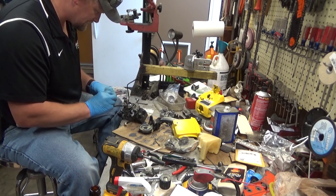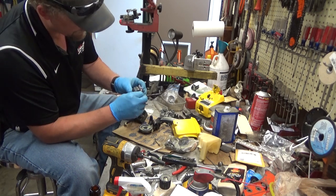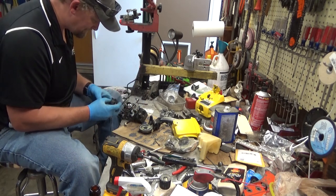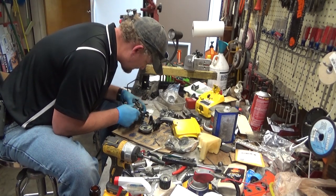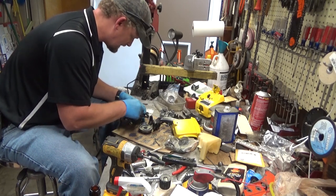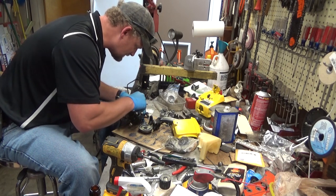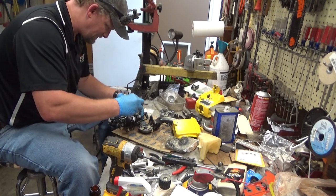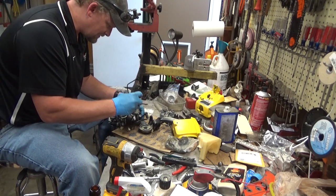Coil sits over the top of those next two insulators, and there's a ground strap on the wire right here. We've got to make sure to get that in place. So just slip that right over top. You'll feel it drop and see it drop into place over those little plastic insulators. We'll get this kind of snug too, but still movable.